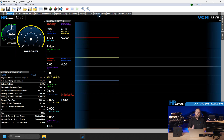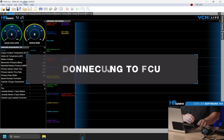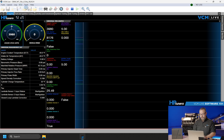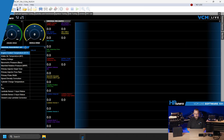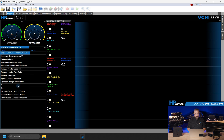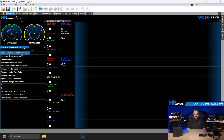Now let's learn to connect to the ECU. First, plug in your ethernet adapter if your PC doesn't include an ethernet port. Then connect to the ECU and you're online. The sidebar contains channels you're logging and their rates. You can change the frequency, add measurements, and customize your view. Now let's discuss the universal measurement list. Here are the channels that you're logging and the rates you're logging them at. If you right click on a channel, you'll be able to change the frequency at which you're logging, as well as the unit of measurement and how many decimal places you want to record.